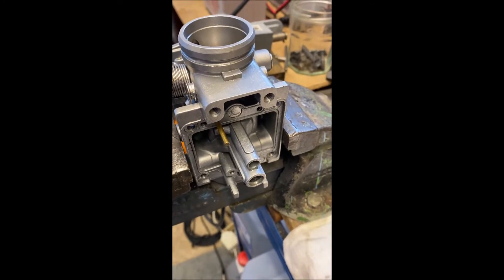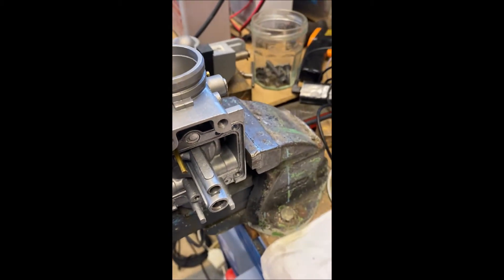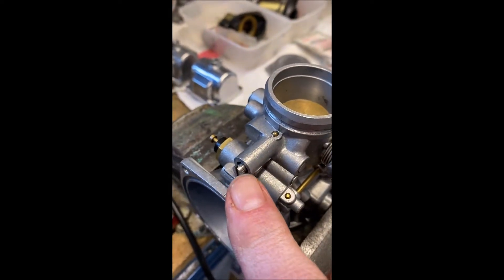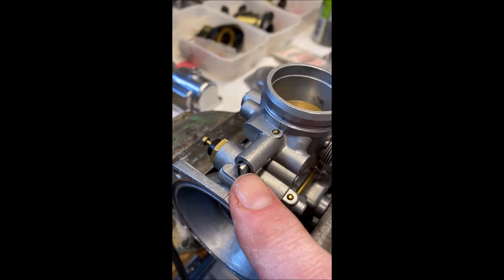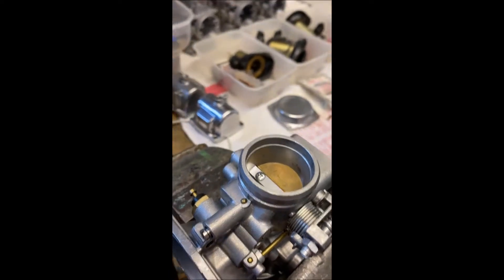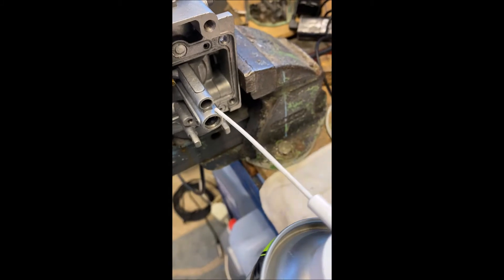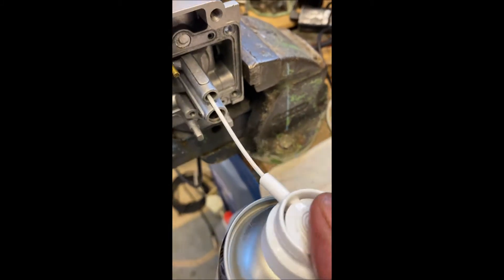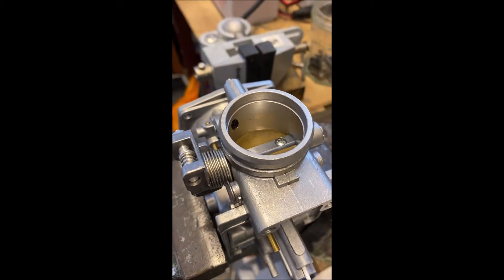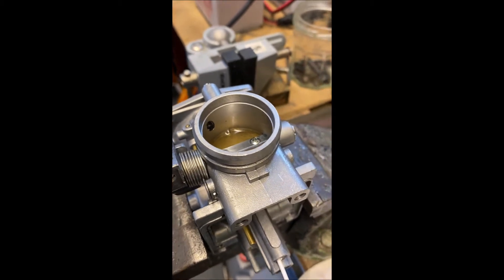Pilot circuit. You need to take the pilot jet out and have your screw adjuster mix thing in — I've got it about halfway out. Take the old Cobra nozzle, shove it up here, nice thin nozzle, get it right in as far as you can go, then squirt. Nice clean circuit there.